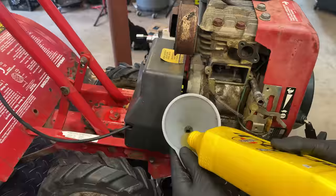So I think we're at the point where I can get the valves reinstalled. These valves don't use keepers, it just uses this cap to lock things in place. So it's fairly easy to install. But before I do that, I just wanted to highlight an additional problem I found with this engine. So far I've found excessive clearance on the exhaust valve, scoring on the cylinder, and now I found an issue with the intake valve.